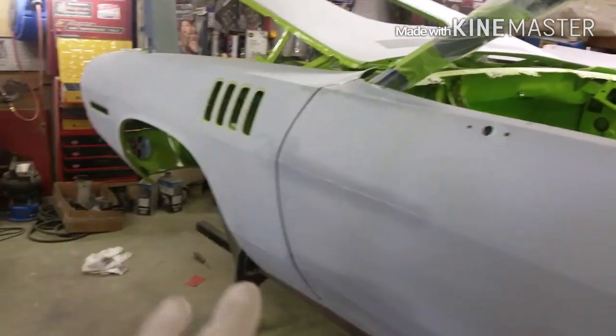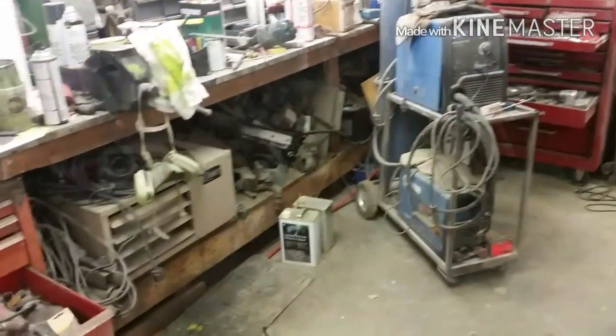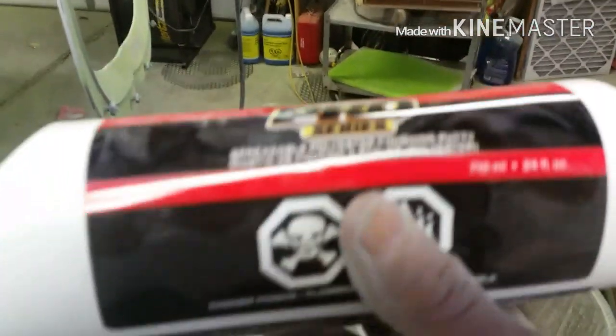Alright guys and gals, it's your mid-morning update. Things don't look much different but I've been doing a lot of sanding — got this whole thing down in 400 grit and I'm happy with it. For the little chips and nicks I'm using this stuff here, Pro Series — it's a two-part, you mix it with hardener just like filler. I used to use that lacquer spot putty that came in a toothpaste tube, the brown or red one, but I was advised not to use that.